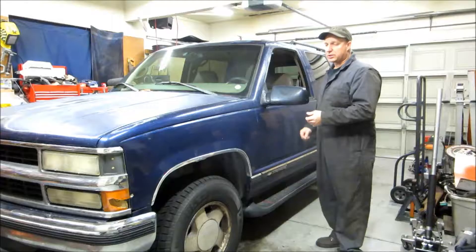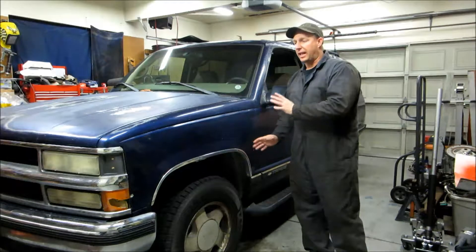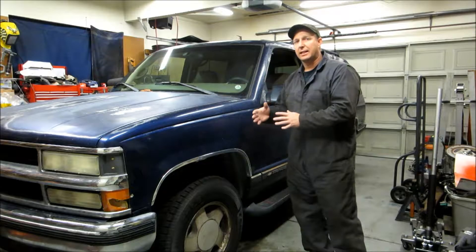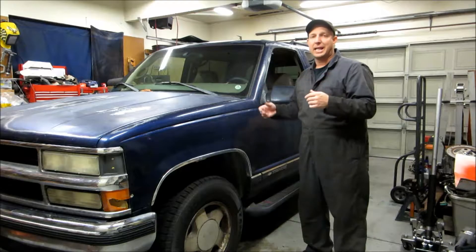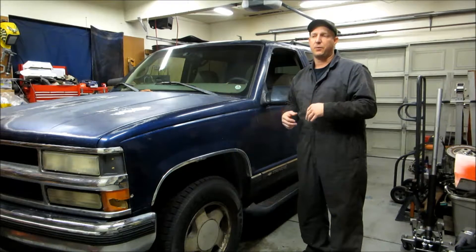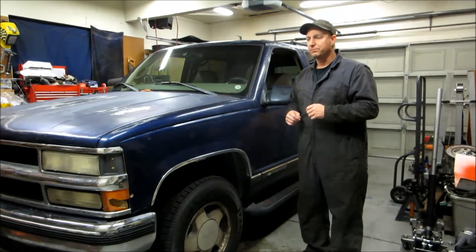We just got back from our test drive and there are no leaks in the front or rear differentials. I double-checked the levels and they're all full. On this front differential, this applies to basically any independent front suspension GM truck — they all have the exact same front differential, same drain and fill plugs. In the 2000s they start using synthetic fluid; 1999 and older takes regular 80W-90 gear oil. In the rear, 2000 and newer also uses synthetic gear oil, but pulling that diff cover is exactly the same for all years and all makes from 1500 all the way up to 3500. There might be a cross member or track bar in your way, but they all pop off the same way. Thanks for watching White Collar Garage.